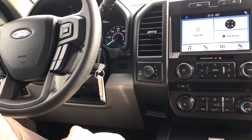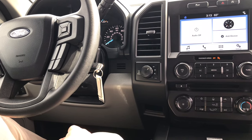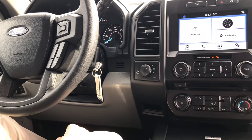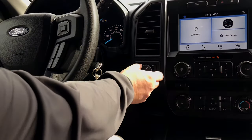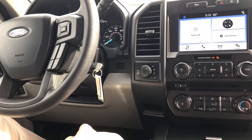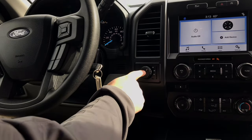Four-wheel drive technology in a new F-150 is very simple. There is a knob that carries out four functions. There is locking your rear differential, which is simply pulling the button outward — that locks the wheels to run in unison. If you wish to deactivate that feature, you push inward.